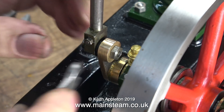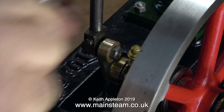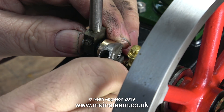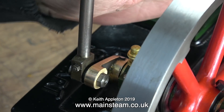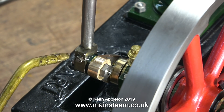I'm using an ordinary spanner, not my Bahco spanner, because it's not in a good place for a Bahco. There isn't much clearance for the jaws of the spanner around where the nut lives. But this other small spanner seats quite well, and in the end I managed to give the nut a final tighten using the Bahco. It's of paramount importance that this nut is tight. If the crank pin works loose and falls off when the engine's running, the engine could be damaged.